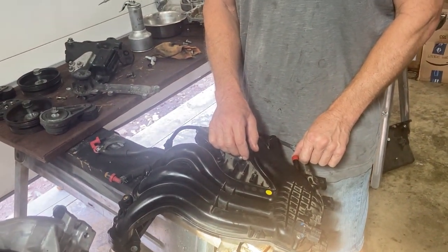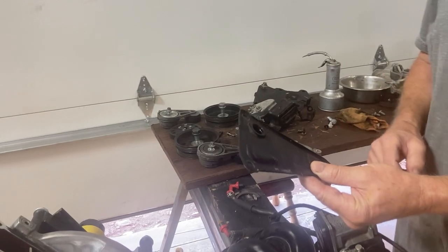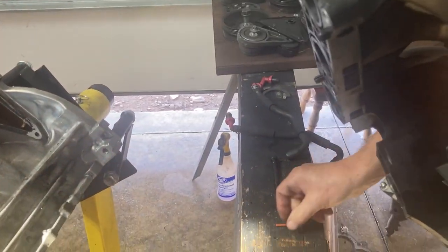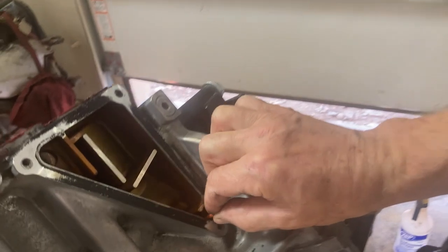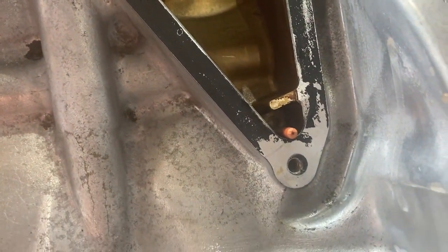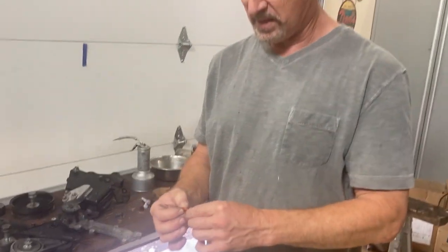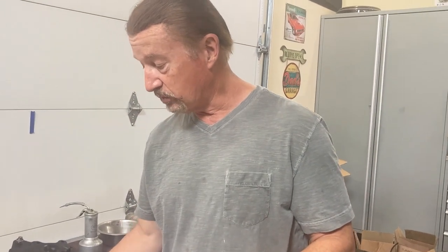Just unhook it, put a cap on it, start it up - if your smoke's gone, you've got your smoking gun. This is the actual piece that holds the PCV valve. On both of these engines, when I pulled these off there was a little plastic pin laying right down in there when I took the cover off - that's part of the PCV valve. If you're just pulling the intake back and switching the PCV out, I don't think it'll hurt anything laying there. If you're a perfectionist, take it off, get your pin out, and put everything back together.